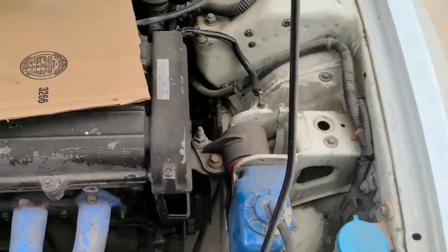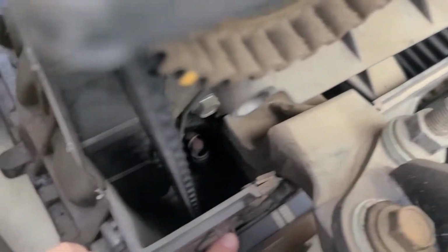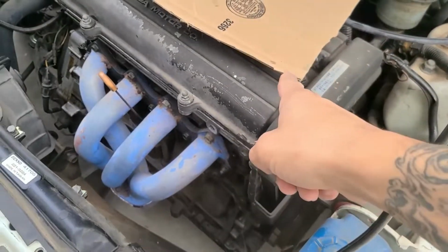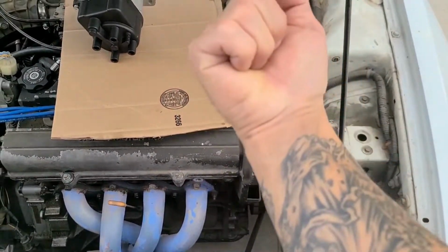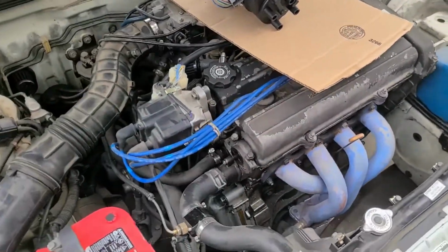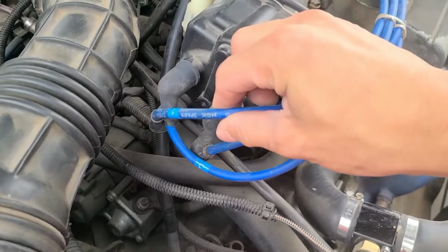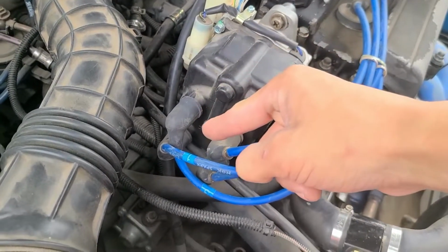Basically, I'm going to look for the marks on the pulley itself and line it up, so you guys can see that marking right here. Other ways to verify this: I can take out the spark plug from cylinder 1, put a long screwdriver down there, and once it's fully upwards, that should be top dead center roughly. Another thing I'm going to do is take the cap off the OBD0 distributor, and here is the firing order for 1. I'm going to see where that rotor rotates to, where it's pointing there.